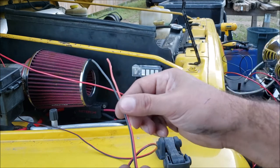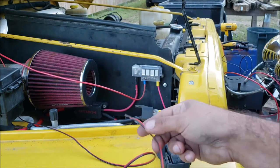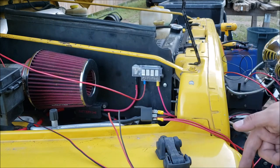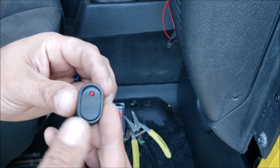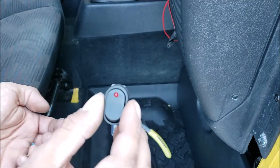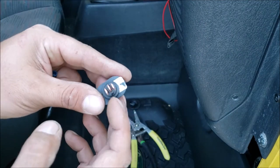Pin 86 is going to be power from the switch, and pin 85 is grounded. We can go ahead and run both wires and ground it in the dash — that's what we're going to do in this situation. The wires twist around the relay for now — this is not the official final setup; mine are going to be powered from the fog lights, which we're going to do next. Switches with lights on them are a pain to run, but the fog lights really do want one.